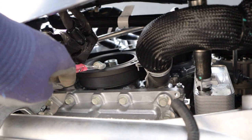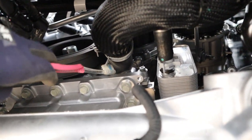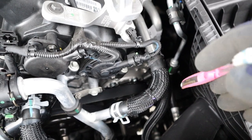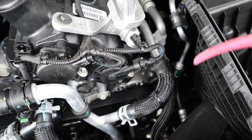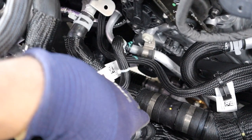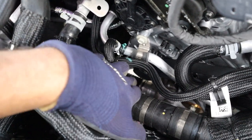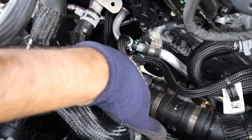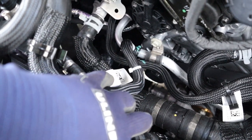Here's a look at the engine from underneath — you can see the crank pulley, the upper oil pan, and where the lower radiator hose goes into the water pump. Servicing the AC compressor isn't too difficult; you have a little bit of room to work on the side to get its bolts off and it comes out through the top. The alternator on the passenger side looks a little daunting because of all the hoses in the way, but it's actually not too hard — you've got the pulley and the bolts on the side of the engine, then it should come out the top with the hoses moved.